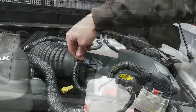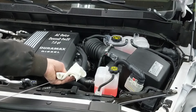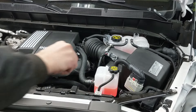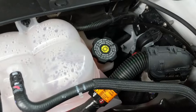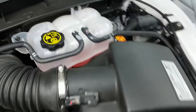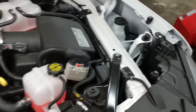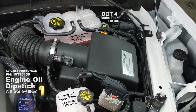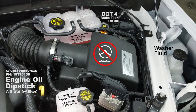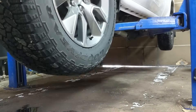All the fluids are on the driver's side of the pickup. Here's the engine oil — it's got a cable-style dipstick, which I like. There's no transmission dipstick; we'll see how you check transmission fluid when we get underneath. Brake fluid is hiding back there and takes DOT 4, which has a higher temperature rating than DOT 3. Windshield washer reservoir and coolant tanks are there too. You'll also notice there's no power steering reservoir — this has electronic power steering, which is what everybody seems to be going to. One less thing that can leak.